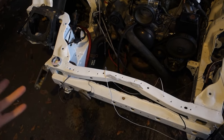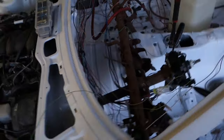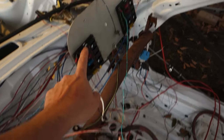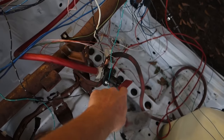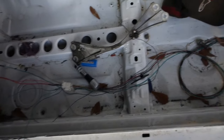It's pretty much the same but I got the headlights, turn signals, and all that stuff actually mocked up on the car and operating. I could probably have done it an easier way. I'm not using the factory harness — basically building my own harness — but I really wanted the factory switches to work so it feels like an FD when you're in it. This is a temporary fuse panel which will be down where the AC and all that stuff would be, tucked under the dash. This will be the main power shutoff, right here where the radio well usually goes. The ECU's down there in the corner — I'll make a bracket to tuck it away. Got the relays for the headlight pop-ups right there.